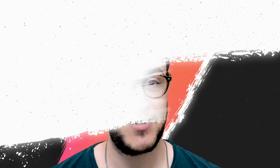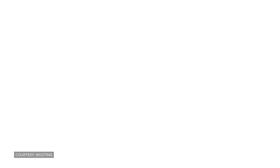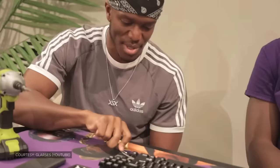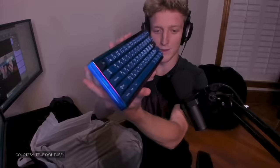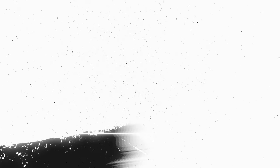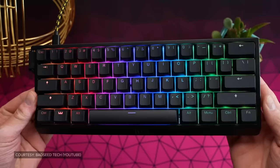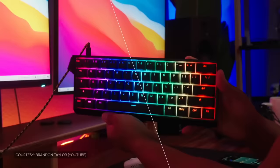They released a full-sized keyboard the following year, but they weren't done there. Wooting wanted to improve on their initial creations, so in May of 2019 they announced their own switch. Unlike normal switches, Lekker linear switches have a magnet on the stem and react to the Hall Effect sensor on Wooting's PCBs, which gives you a full range of analog inputs from 0 to 4mm actuation. Over the past few years, custom keyboards exploded in popularity, with more people customizing every aspect of their board and building in smaller cases. So the next logical step for Wooting was a 60% keyboard. They crushed their initial production goal of €75,000, raising over €250,000 from nearly 1,300 contributors. And once everyone got their hands on the 60HE midway through last year, the consensus seemed to be that Wooting really created something special.